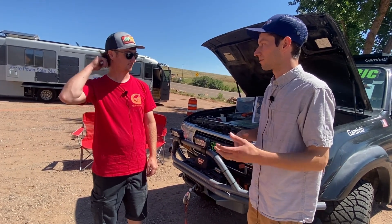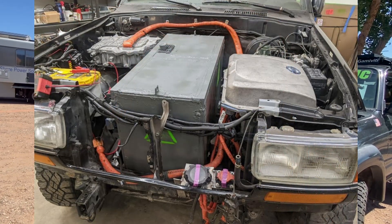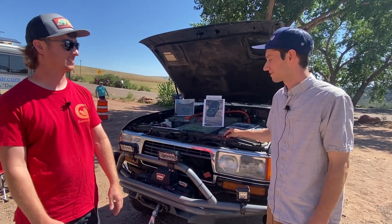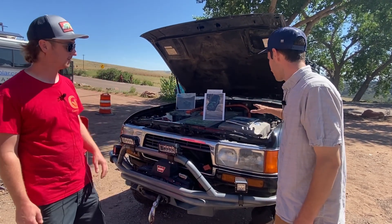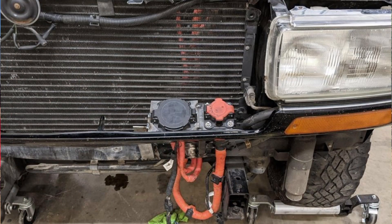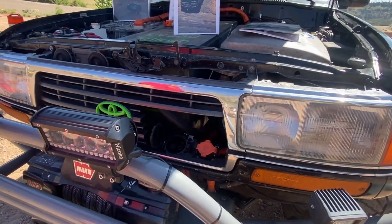Was it hard to mount the motor and everything? It was definitely a challenge, but it kind of all pieced together — one little section at a time, and the end result fit together. The battery fit under the hood with less than an inch to spare, and the motor has less than an inch clearance to the battery. This is the battery pack from a Nissan Leaf, and I've got a CHAdeMO fast charger so I can do DC fast charging. You can pull right up to the plug and charge, just like on the Nissan Leaf — it's on the front. And it's legally an EV now in Colorado, so I'm allowed to use those chargers.